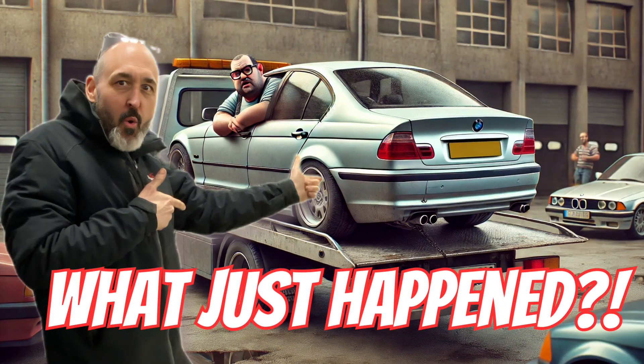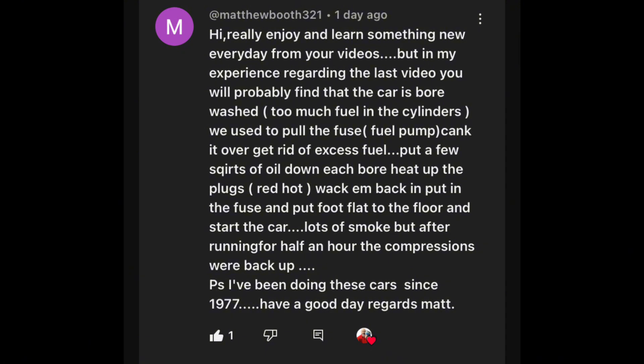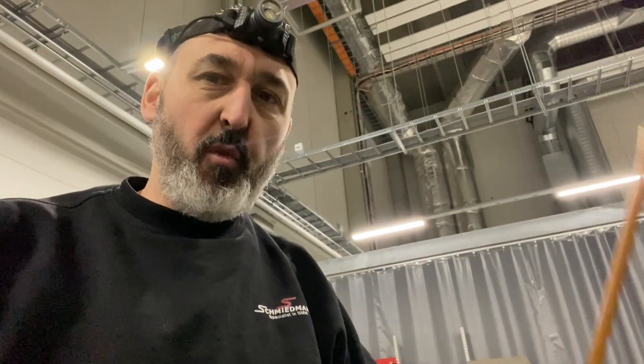I've got this one from yesterday - the E46 with the compression issue. I'm going to try something one of the cool guys on my YouTube channel suggested: pull the fuel pump fuse out. I've done it years ago but forgot about it. Put some oil in because you've got low compression, heat the spark plugs like hell and drop them in fast and try to crank it. First we'll spin it over with the fuel pump fuse out to clean all the fuel out.